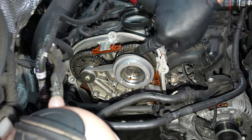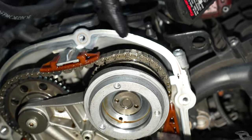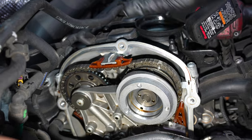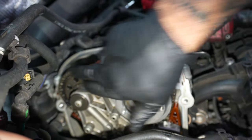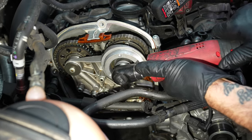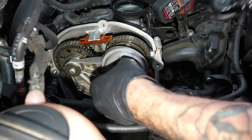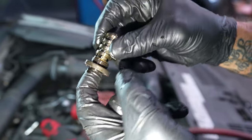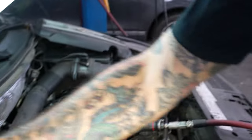All right, you can see our timing marks — one here, one here. You know you're pretty close when this one's straight up and down and this one's back here in the 11 o'clock position. Reverse thread. Spool valve — check it, make sure it moves good. Push on this — nothing jammed in it.